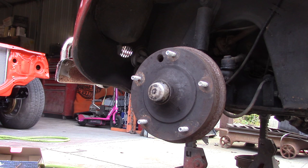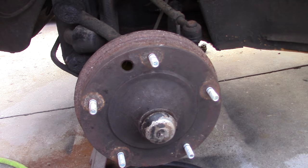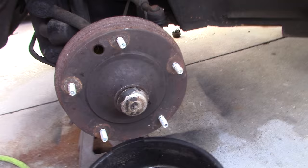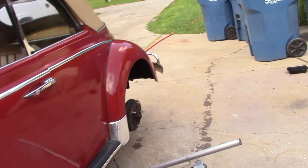So that's pretty much what we're doing — it's a drum brake job. Of course we didn't replace the drums; these drums are sort of rare and this drum still has plenty of material left on it. The shoes were just a little on the thin side. We'll repeat that process on the other side and we'll have brakes again. I need to put an axle boot on the rear — maybe I'll turn the camera on for that. I've had a couple of people ask me about those; they're pretty easy.